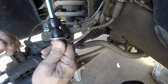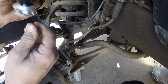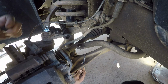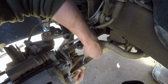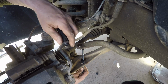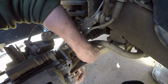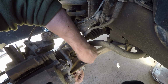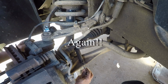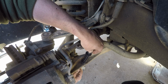And then I'll leave you with this, okay? Same deal, this goes on top, this goes on bottom. So we don't need to take this off. All we gotta do is thread it up through, put the new bushing on there like it came off, slide the shaft down on it, and then get the bushing that just dropped. Goes on top of it like so.